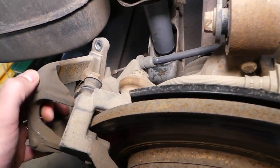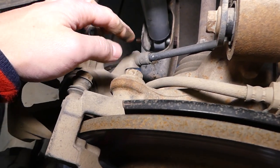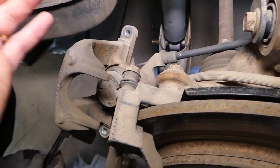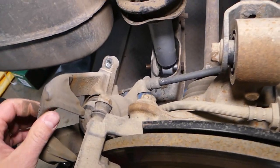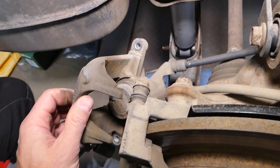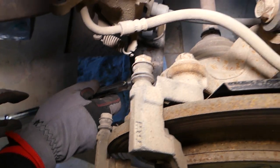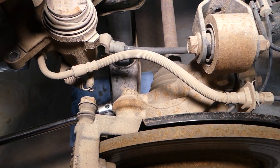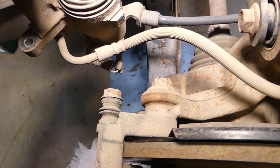You can see the emergency brake cable is holding the caliper, but if the caliper is hanging too much you can damage your brake line. If you suspect it's hanging too much, tie it to the strut so it's not in the way. Now we have an 18-millimeter socket — we need to remove the bracket here for the caliper and get those bolts loose.